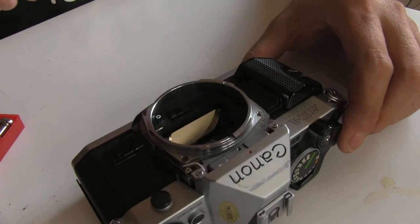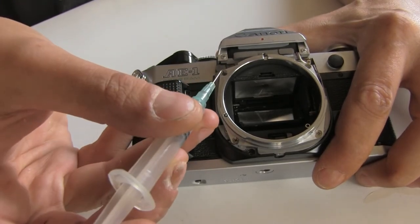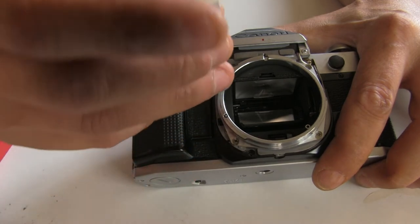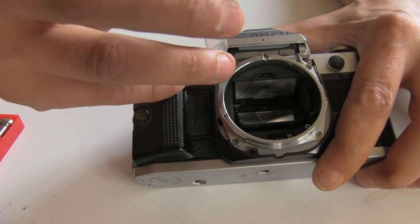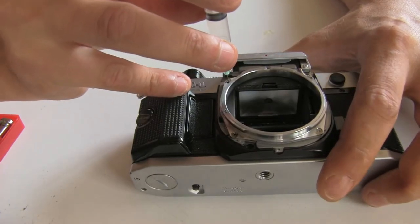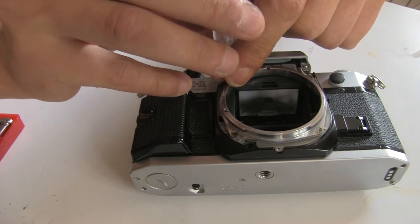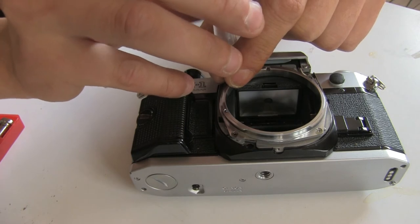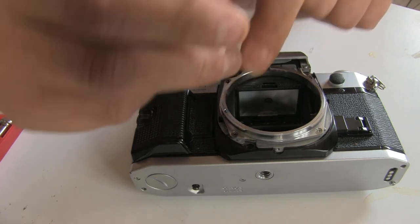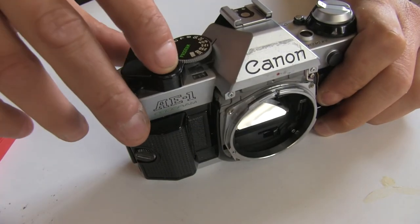I'm gonna take the camera and try to do this in front of you so you will see how it goes. You insert the tip of the syringe inside the camera body. You will feel it — you'll feel this is exactly the inertia wheel that makes the mirror dampening, but since it's stuck it makes this squeal noise. Now I'm gonna hold it like that and push it quickly, then remove it, and now you can play with the camera a few times.